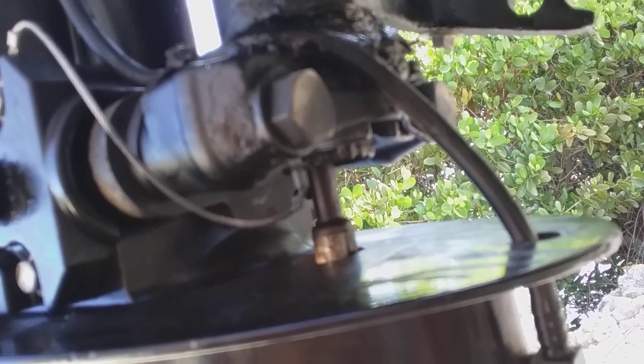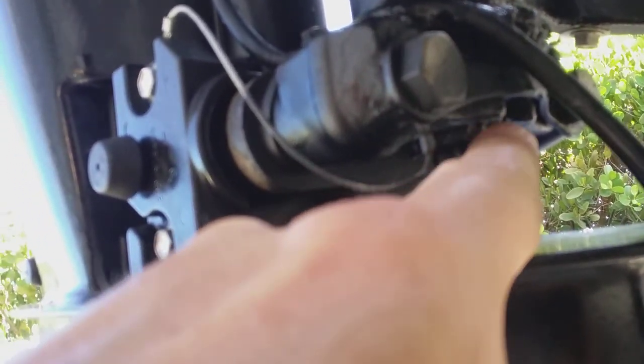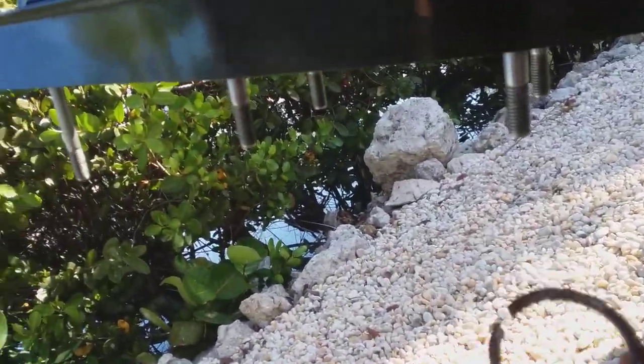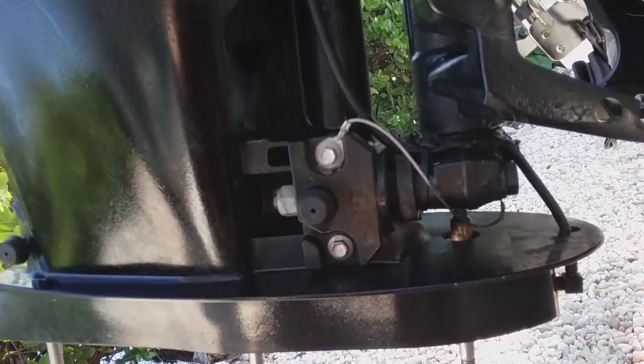Mine was kind of a little rusty here and there. It's not that old a motor with low hours — 200 hours. What I did was I sprayed it with that rust stopping rust converter, the black stuff you can see here. I sprayed this whole area with that converter and I just took the ring off — was able to get it off around that shaft, pulled it right off. The ring is supposed to be split and it's called a retaining ring for the bottom of your swing arm shaft. It's a common Mercury problem and I'm just going to protect it as best I can rust-wise. Maybe I'll throw a little grease up in there and then I'll put the side cowlings back on, which cover this whole area.